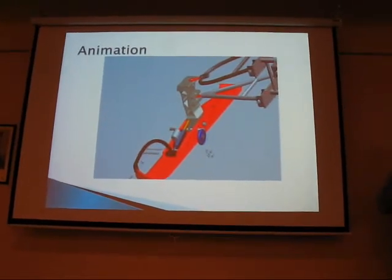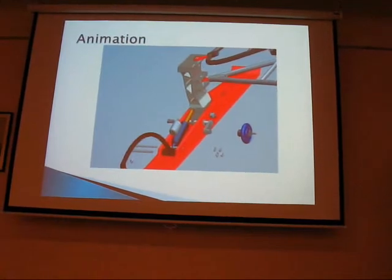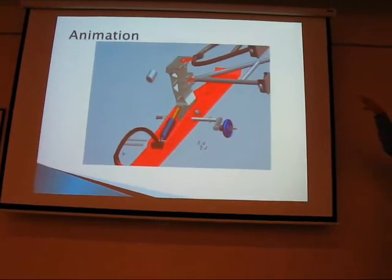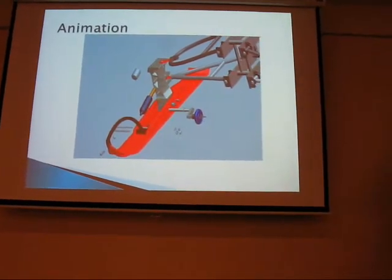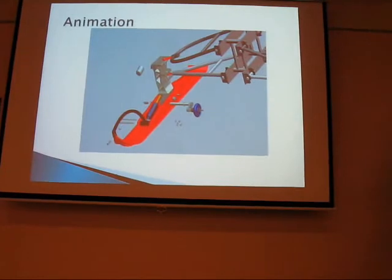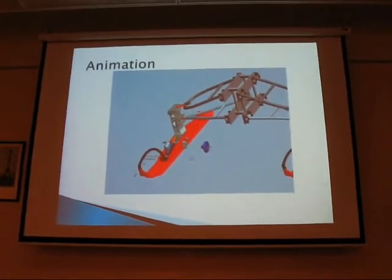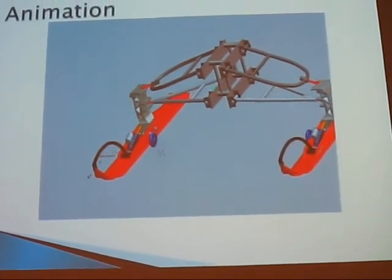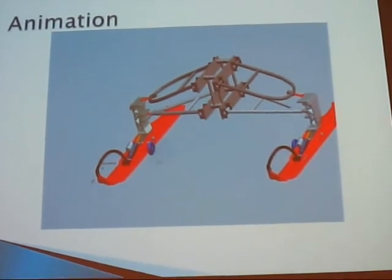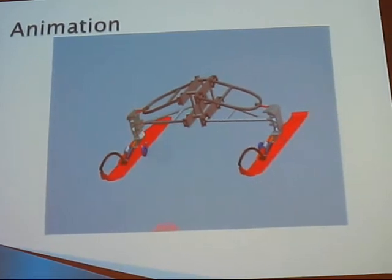The linear actuator just bolts on. It will be wired up through the frame to your battery, because most sleds have electric start with a battery that you can tap into, then run a switch — push it and the wheels go down. It'll be very quick, and you won't have to get off the sled to operate it. Most people won't hop off their sled at a road crossing. It would take about 8 seconds to cross the road with the wheels lowered, and as soon as you get back on, it saves wear on the carbide.